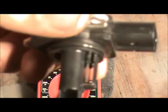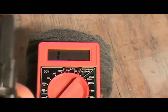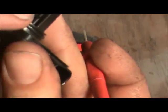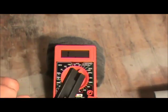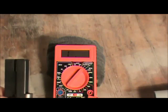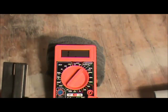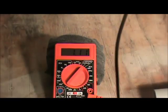Now here's the newer combined unit — this is also the intake air temperature sensor, and you can measure it from two different legs. Here's one leg and here's the other. Be careful not to damage the terminals. The reading is about one point one kilo-ohms. Now I'm going to get this one closer to the heat source.